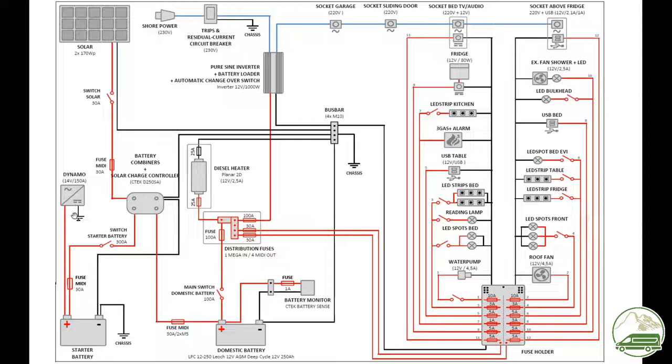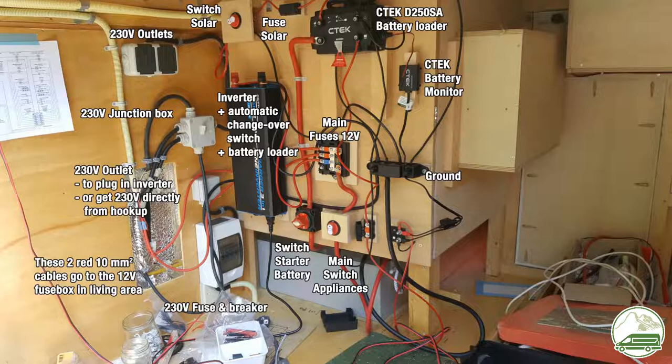So we'll just have to see how this holds up in real life. As we speak, we have done the first few trips with the van and this premise seems to be holding up. Now looking at our finished panel, I want to show you how our design translated to the real world. First off we have the battery right below the panel here. From the battery this red cable comes up through the main switch, so the whole 12 volt system can be switched off by this switch. From the switch the red cable goes to the main fuses — all the bigger fuses of the system are located here. And from here two smaller red cables are going up through the van to the main fuse box in the living room.